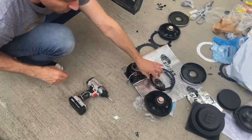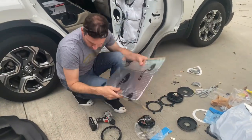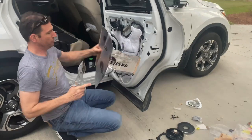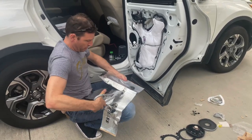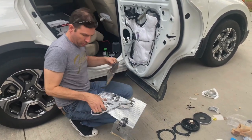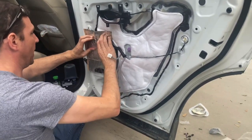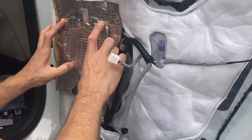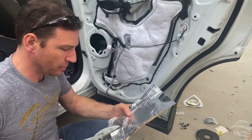Now that I've got that done, the next thing I'm going to do is mount the ring. In order to mount the ring we're going to need some kind of sound deadening material behind it. I'm using this generic dead mat. What I do for the dead mat is just get a piece roughly bigger than the hole. I've got shears here, but this stuff will cut with scissors — the shears are just a little heavier. To do this efficiently, we press it over top, we can see the cutout and the round, and then press so we can see where it fits.